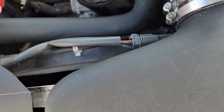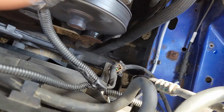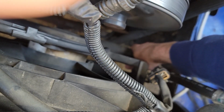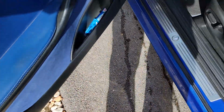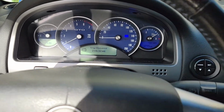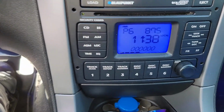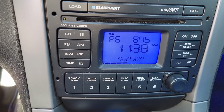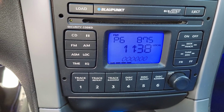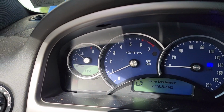This hose has been hot for a while because that's coming directly from the engine into the radiator. Yeah, this is pretty much completely cold down here. Guess that's just the radiator doing its job and getting rid of the heat. And we're just about at temperature. We're at a little over 12 minutes, so maybe we saved 2 or 3 minutes by dumping those 2.5 quarts out. Not enough. Still, now it's climbing quick because that thermostat's open, and we're just about up to temperature.